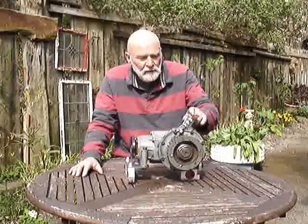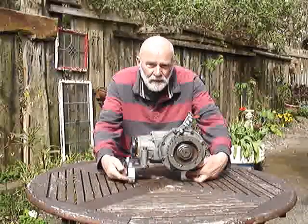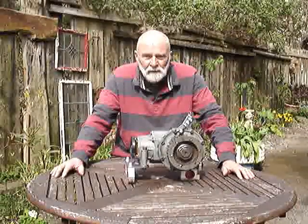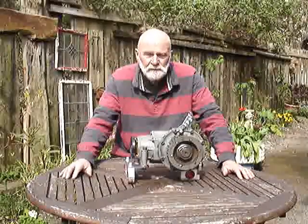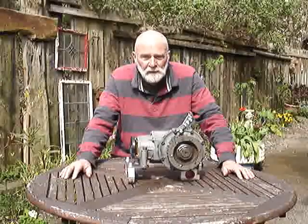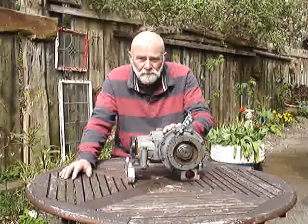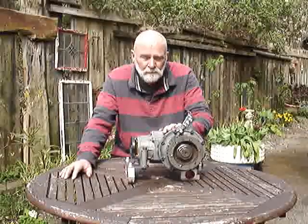You'll notice that I have little red polyurethane liners inside all the clamps. I don't feel it's a good idea to be clamping onto a chassis tube and creating little areas of stress at the edges of the clamps. I also feel there may be some merit in isolating the high-frequency whining noise of this thing from the chassis, although I don't think that's very important, to be truthful. But I do it anyway.